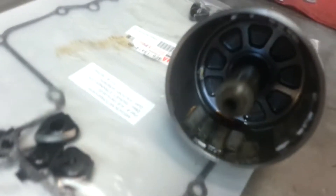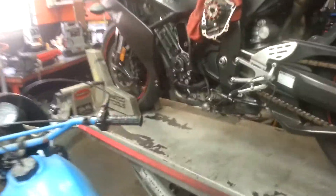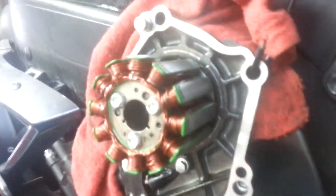It's hard to see. Here's the other one that went bad. You've got to clean the engine out the best you can — this stuff is going to go everywhere. You've got to pull the pan. Here's the bike over here — I put it back together already, but I pulled the pan, cleaned out the strainer, it was full of debris, cleaned out the bottom of the engine. Here's the hole. The stator was okay, we think, so we're going to try to run it with this new rotor — the stator wasn't too chewed up.